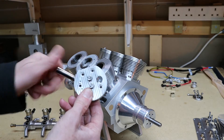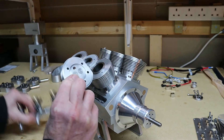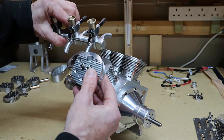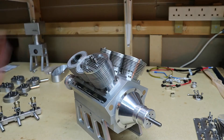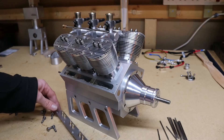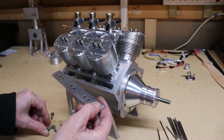The exhaust port I was able to screw in. But with the actual carburetors, they're just going to have to be pressed in, so I'm going to have to put them all in at the same time. Now that the cylinder heads and the carburetors are on, I can put the camshaft covers on with the tappets, so I'll do that now.